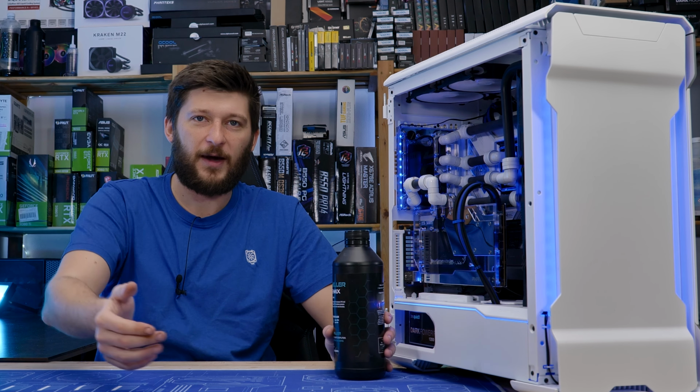This is my stuff. Now, before we end this, I did redo the same, I won't say benchmarks, temperature benchmarks that we did with the original Phanteks AIO, the MP360, and with the NHD15. And to give you some numbers, with the original Phanteks AIO, the system was unable to keep up with 5.1 GHz. Just unable, it hit 100 degrees C immediately. With the NHD15, it happened even quicker. And then it slowly dropped to 5.0, 4.9. Now with this setup, with the same settings, we are sitting at a very stable 5.1 GHz on the P-cores and, what was it, 3.8 or 3.9 on the E-cores.